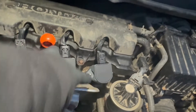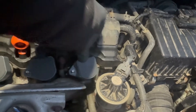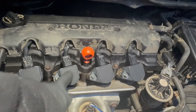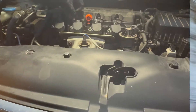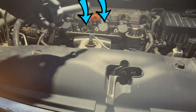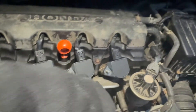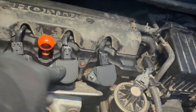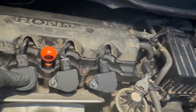Notice the change here — the engine was trying to stop. There is also a change in cylinder four, so those two are good. Cylinder one is good as well. So we've found where the problem is — it's this cylinder. Now let's confirm if the ignition coil is bad or the spark plug. To do this, switch the ignition coil from the bad cylinder with a coil from a good cylinder. There is no change when I remove this coil, which means this coil is bad, because this cylinder was good when this ignition coil was in it. So this ignition coil is definitely bad.